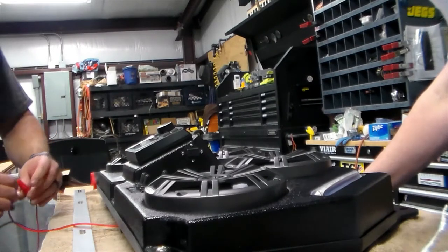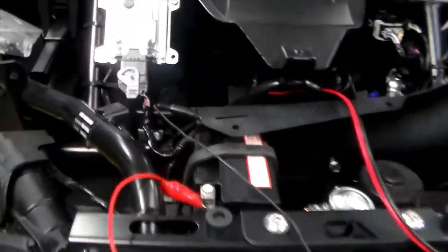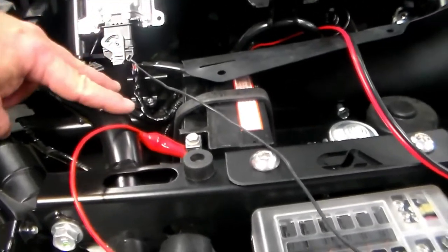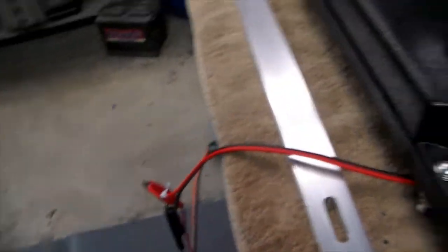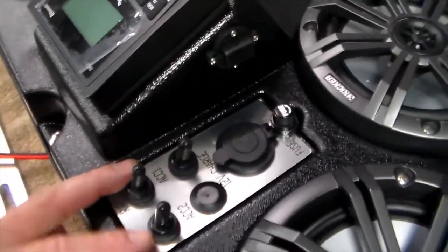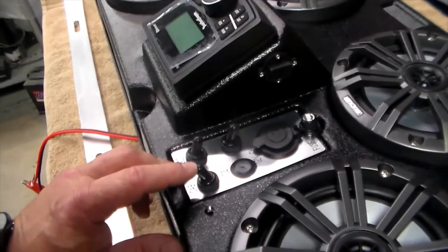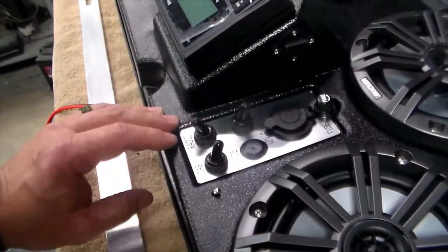Run the main power wire from the vehicle's battery to the top side of the radio — leave plenty of wire. Don't connect wires to the battery yet. Use tie straps or wire loom to secure wires to the roll cage. I cut out the middle and went straight to the battery we're going to use to power this thing. Got red to red, black to black. One thing I like about it — it's got a control panel with switches, and ultimately this will go to a keyed fuse box, but I like that it has its own switches.